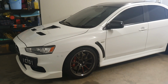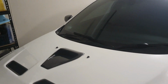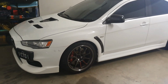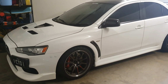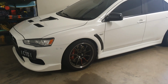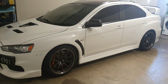I've actually bought a dual action polisher. I've bought some eraser, some boost, and also some purify. So my aim with this video, after looking at several videos online, is removing the contaminants from the car's paint, doing a full correction using a compound to get rid of any swirls, and then doing a polish and then a further refined polish, using two different types of compounds and two different types of polish on my car.